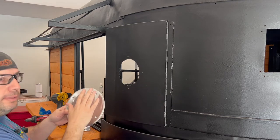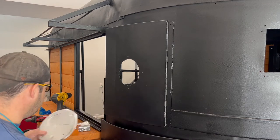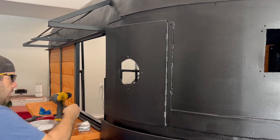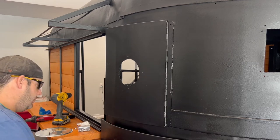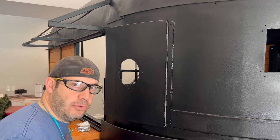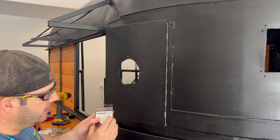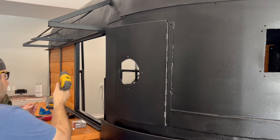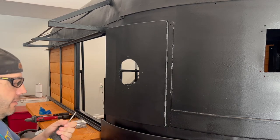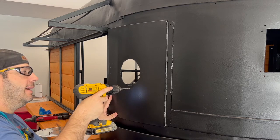Okay, you wanna pull, these come with some plastic on there. Just pull that off, it's protective plastic. Now we're gonna use a, remember, when we drilled out the center of the rivets, we used a 9/64 drill bit. Now we're going to use a 3/16, because these rivets are 3/16 wide. So we got a 3/16 bit. We actually want to drill this out.